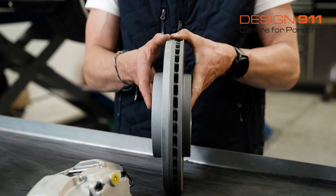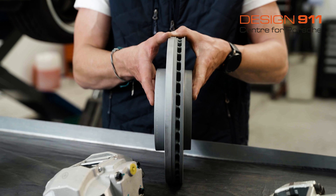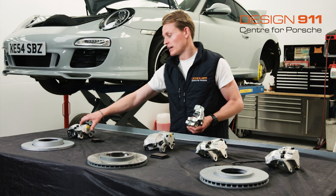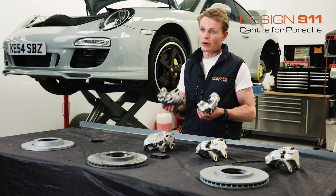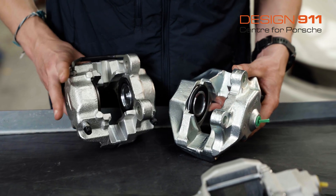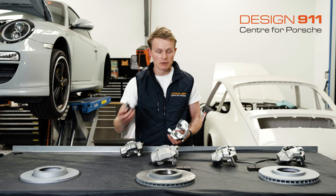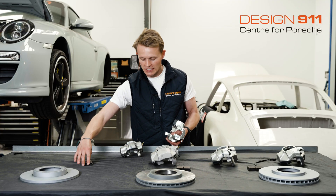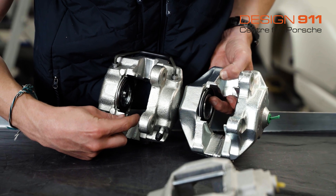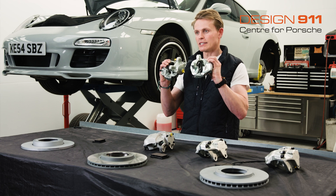You can see here how this disc is both thicker and vented compared to this one. The M-type caliper is almost identical in body or housing to the one used on the previous 911s. It still has the same three-inch mounting pickup points and uses the same brake pads, but it differed in that the cutout in the middle was much wider, allowing the use of a wider brake disc.